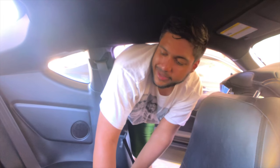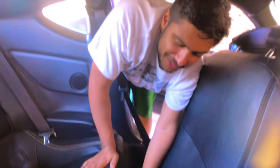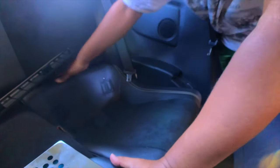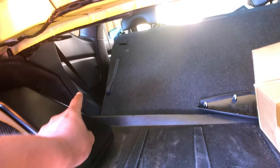Taking out part of the back seat so that I can run the wires through the plastic trim and into the trunk for the sub enclosure. There's a 10 millimeter bolt right in here that I just popped out, which allows you to lift the seat up. You have to shimmy it forward a little, push down the back and lift up the front — and that'll just go. Remove the trim and a whole bunch of clips pop out, so you pull your wiring harness around behind the trim on the driver's side of the trunk. It installs with one screw on each side.